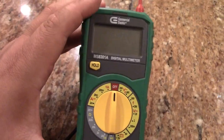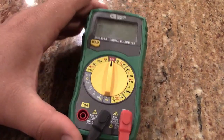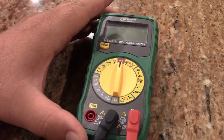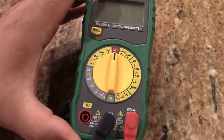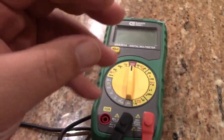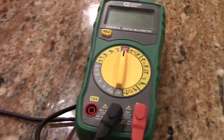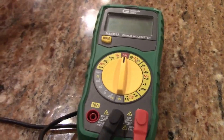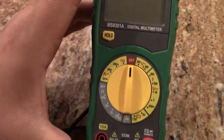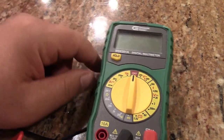Last time I was here we needed this meter because they have a Honda CR-V that didn't start. He gets the meter out and puts it on the battery — the car had some juice, the lights ran dim, so it should be reading eight or nine volts. But it was reading nothing. We tried it on another car with a good battery, which should read 12-point-something or 13, and still got absolutely no reading whatsoever.